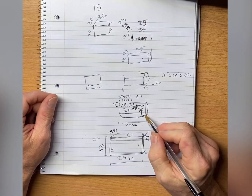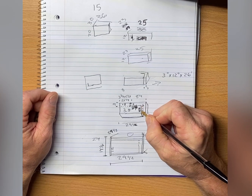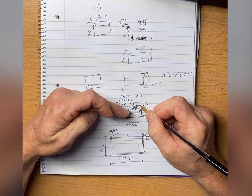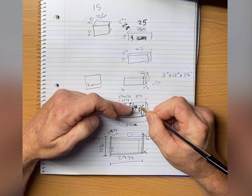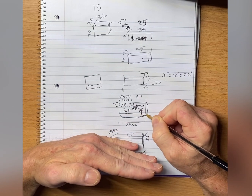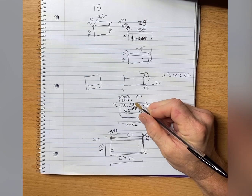As long as we maintain 3 inches of port here, you gotta be real careful with the wall placement. This one right here, for instance, you're gonna want it to be 21 1/4 and be short 3 3/4 off of this, so that this one can come over and cap it here. You want it to go in behind the wood, so you only see one exposed edge. So you gotta maintain 3 inches.